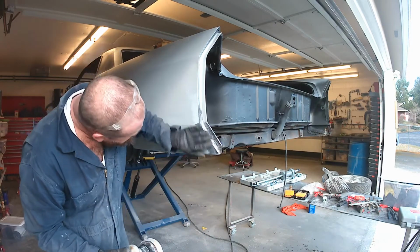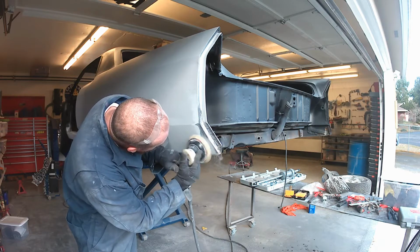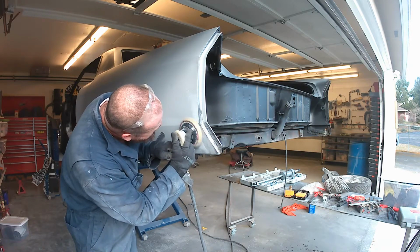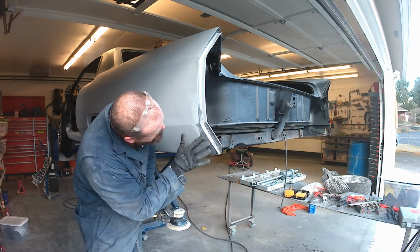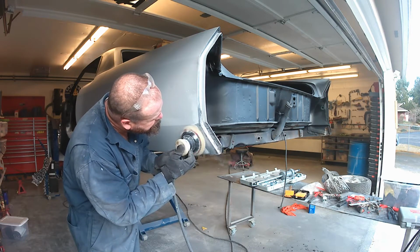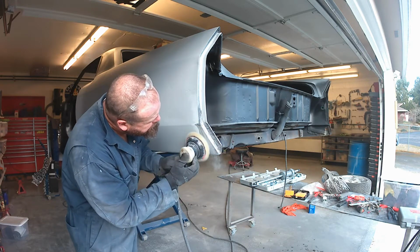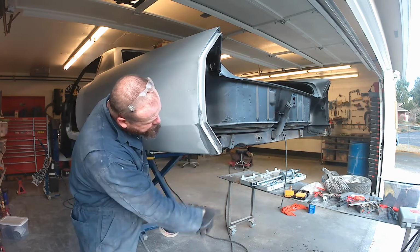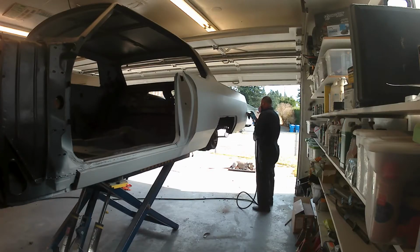Alright, y'all, we got this one wrapped up. Secret to success: take your time. Use something as a straight edge. I just use a 36-inch aluminum ruler, and it works really good. And yeah, take your time. Do a little welding. Preferably do this before you put epoxy primer and feather fill on, but you know how it is. And we'll tease this next video out here.